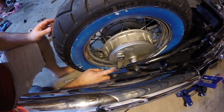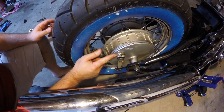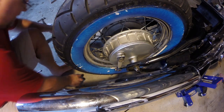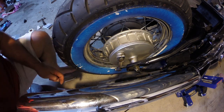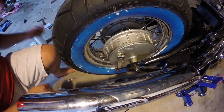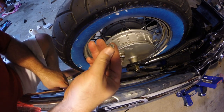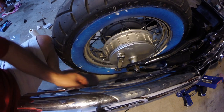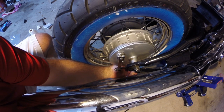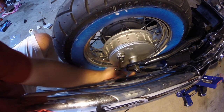I guess I don't need to give that a squirt. That's just gonna stay there. Didn't take that apart, that's still lubed. Everything's clean inside. Okay, now I can put back the linkage. Wow, life's an adventure. Oh, that's why it was snug. It's a half lock nut. That's why it didn't spin very freely. I guess that makes sense. They don't want this one accidentally coming off ever, since it would lock up your brakes. That'd be a bad thing.